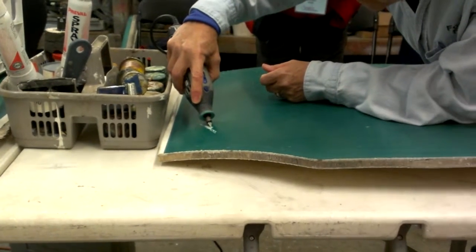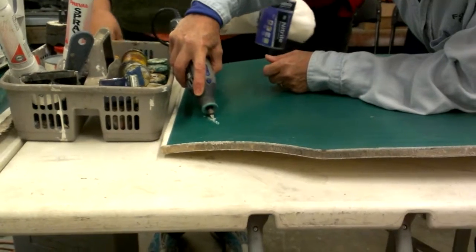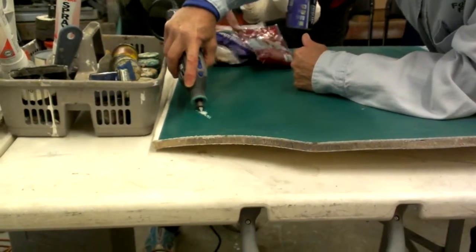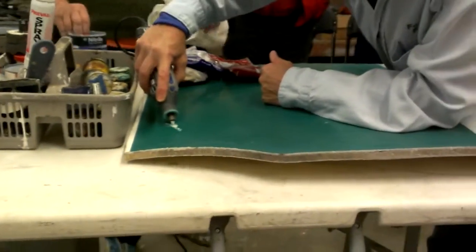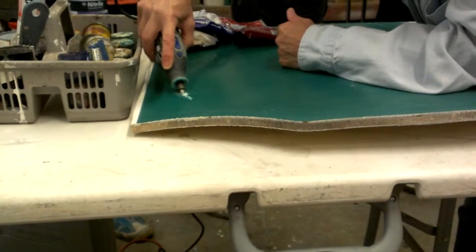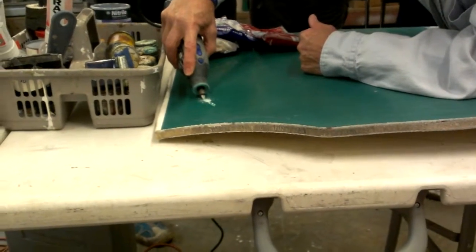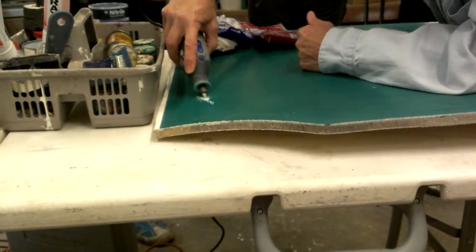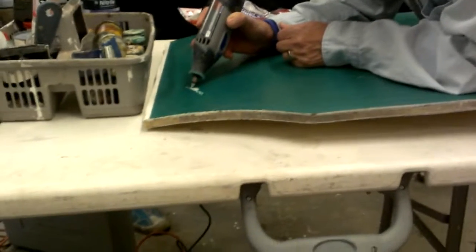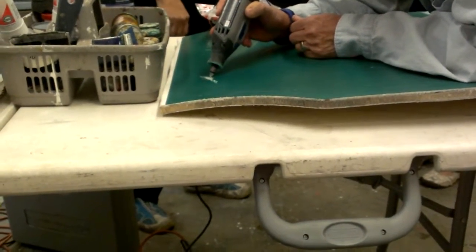So are you feathering it? I kind of. There's a bump in the middle of it. I'm just smoothing that out. What are we trying to do here? You're trying to get loose material out of there. You're trying to get a space that's large enough that will hold the new material. So your normal scratch is like some little bruise kind of thing. Once you've got something that's wide enough, you're trying to make the bevel in it so that you've got more here.